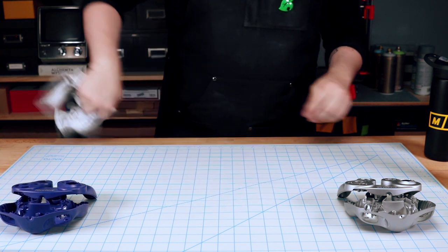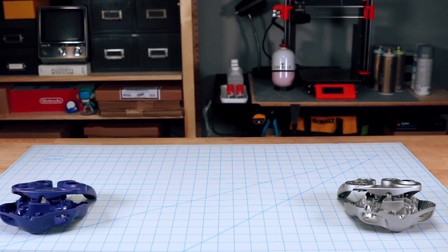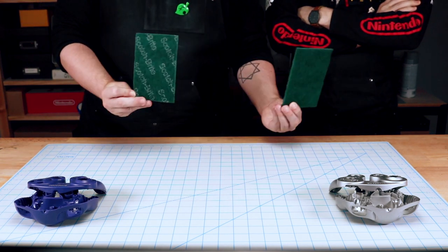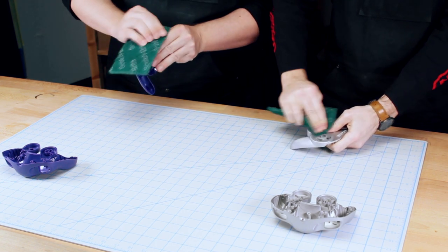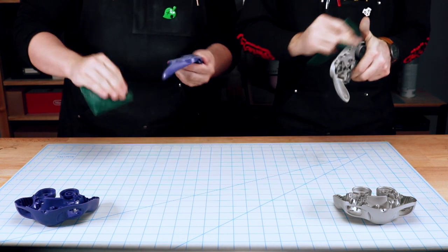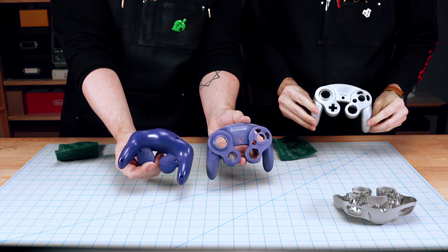Now that 20 years of snacking has been rinsed off, it's time to get them ready for paint. The final step before painting is to hit everything with a Scotch-Brite pad. This final buffing removes the protective coating on the plastic and any grease or grime that might have been left over from the washing. It's important that you don't skip this step. You want to make sure you have a nice surface for the primer to bond to, so your finish comes out super nice.